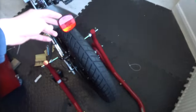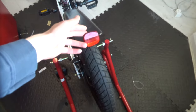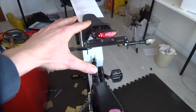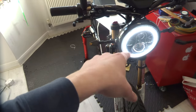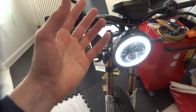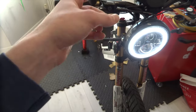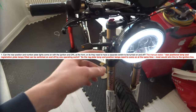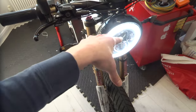For the rear reflector, I've just managed to zip-tie one to the mudguard as far back as possible — that was the only way I could think of doing it and I'm sure it'll work fine. As for the other lights, you can see the position light here, which I've set to come on with the daytime running light at the front. Originally I wasn't sure whether they needed a switch so you could have all lights off during the day, but the guy I emailed said it's fine for them to come on and off with the ignition — so once the BMS is turned on, it's okay for the daytime running light and position lights to come on with that.